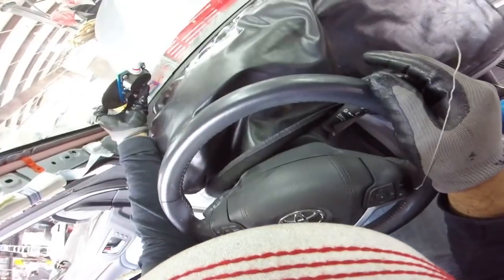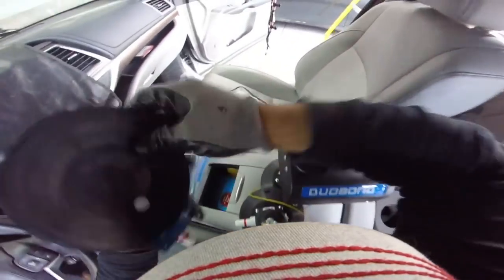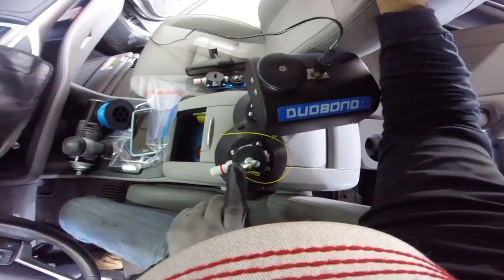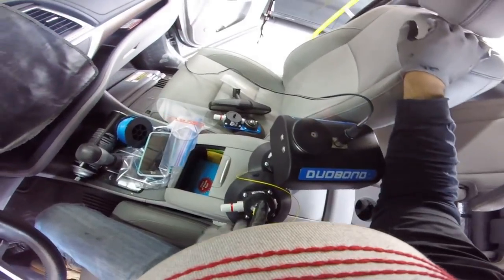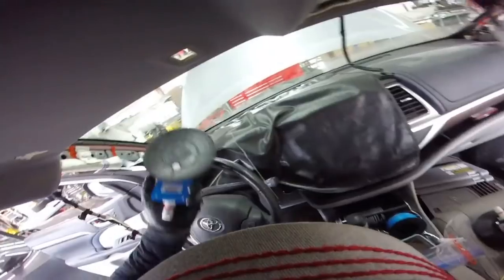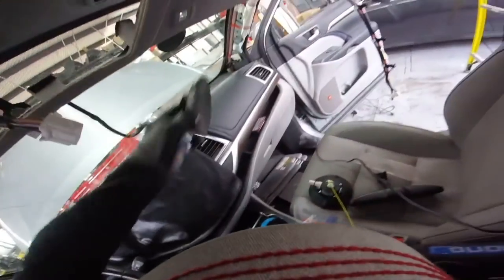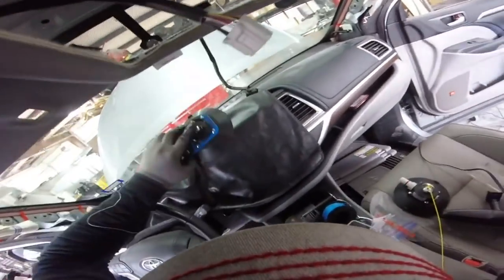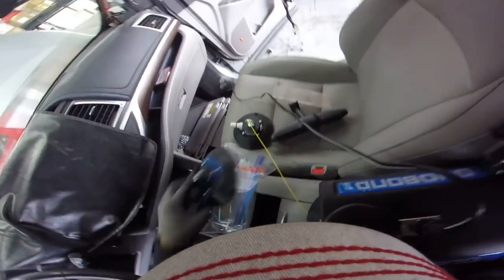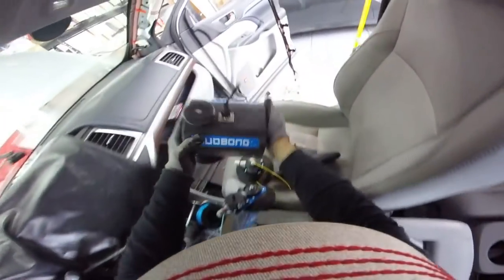You see, the system is nice, but it definitely has a couple of things I think they haven't modified. I'm nobody to say that, but what I would like to change is this one. The technique in some cars like the Honda Accord, the same as in the video on YouTube, works really nice starting here in the corners. But with this kind of windshield, the short and bent ones, cutting to the bottom all the way, here and here, works better for me. I've already tested it a couple of times, so to me it's much better.